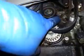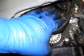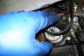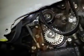The other little trick I was going to show you is something I kind of messed up in my last video. When you release your tensioner, you do not have to fight with that little spring — there's a little spring right here. What I do now is leave everything intact, loosen the set screw and the tensioner, then push the tensioner all the way back with a bar or something and re-tighten it with the spring completely pulled. That releases the tension on the belt so you can take the old belt off. If you want to replace the tensioner, do that and then re-tension it. Put your new belt on and then release the bolt so the tensioner snaps onto the belt and tensions it. That way you don't have to fight the spring and it's much, much easier.